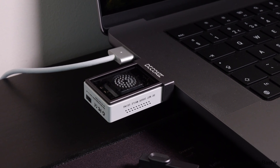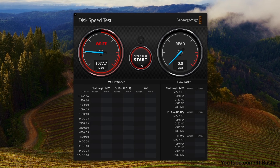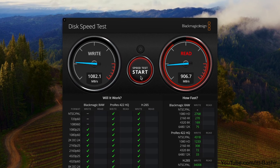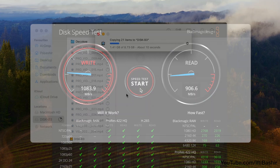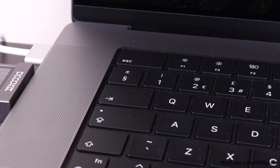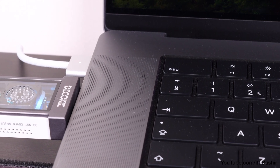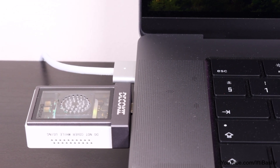It's just fixed in this one gentle setting. More importantly, a disk speed test shows some respectable speeds falling in line with much of the competition, with the bottleneck being the interface. This is pretty much at the top end of what we can expect from USB 3.2 Gen 2, so the results are quite satisfying. File transfers are equally impressive and quick. What's more important is sustaining that speed over longer periods of use, when the SSD inside really does heat up, and thankfully that active cooling fan does seem to be doing its job there too — even during extended use, it continued to sustain its performance with no noticeable drops and no throttling.